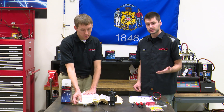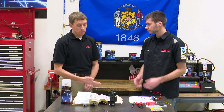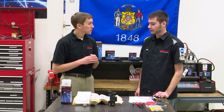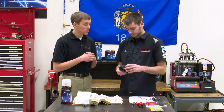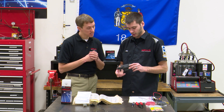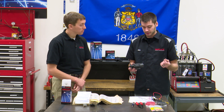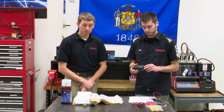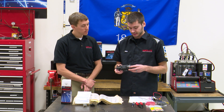We say fuel system because it's intended for gasoline or diesel. The big thing is it's not marine rated — can't use it on that. Also when installing, as called out on the caution label: you need a fuel filter, and you want to keep it under 65 PSI fuel pressure. That's all this is rated for. We're going to talk about the fuel filters in a second.